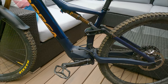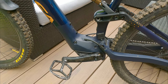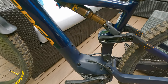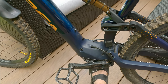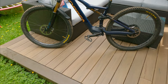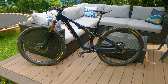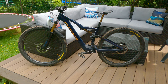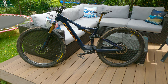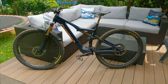One thing I have noticed is it has a low bottom bracket. It comes with 165mm cranks — I'm about five-seven so 165mm cranks is good for me anyway — but even with that, over some of the rougher stuff I'll actually not just strike pedals but strike the bottom bracket a little bit. It's probably a bit of rider error; people who can pull and pop a little more can probably avoid it. With my injuries my strength is terrible, so I kind of just have to take some of those strikes. It hasn't been a big issue though.